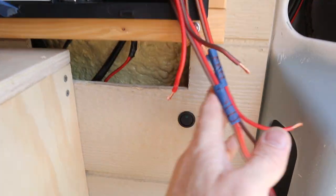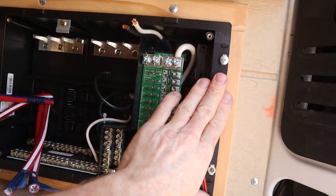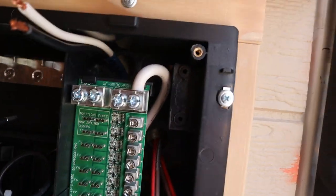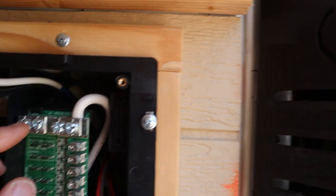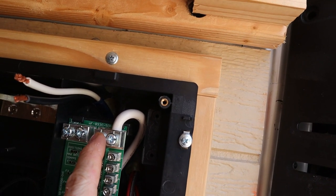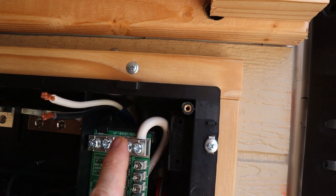My DC appliances include a fan, my water pump, my puck lights, and a PC fan that also has a switch so I can turn it on and off. I need to strip these wires and start installing. I've loosely put the breaker panel in there just so I have a little bit more space in case I need to pull some of the wires more. The first thing I'm gonna install is the cables coming from the battery or from the converter. You got your positive side on the left and then your negative side on the right.